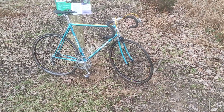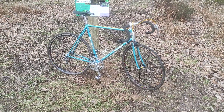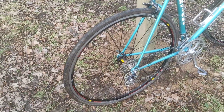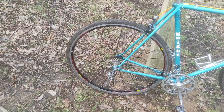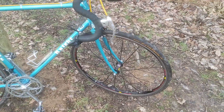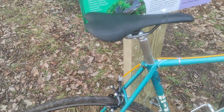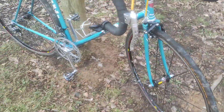Look at that - a 1979 hand-built Knight of Wolverhampton, England. 531 frame and forks, full Dura-Ace 7100. A few little things changed: a pair of wheels, because the old ones had Mega hubs on probably old mesh or Mavic rims that were knackered - went to true them and spokes broke, just a mess. I put these old Campagnolo Elites on from about 2008, which have transformed this bike as you would expect Campagnolo to do. Seat changed just to a cheap San Marco Monza; everything else stayed the same.